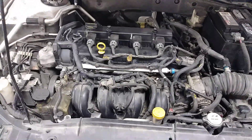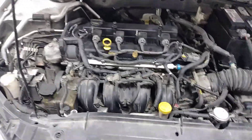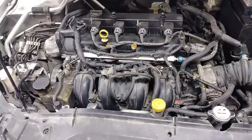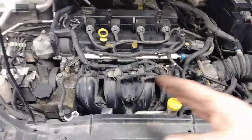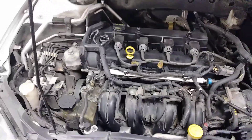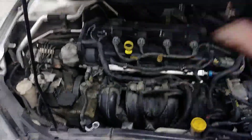It went into place without having to drop everything out the bottom — which I think is the 'proper' way — and I didn't need to loosen the transmission bolt either. So I'd pull the crank pulley off, pull the engine out from the top, and put it back in from the top. I installed it as a long block with oil pan and timing cover, then put the manifolds on and hooked everything up in the car, basically using the car as an engine stand.